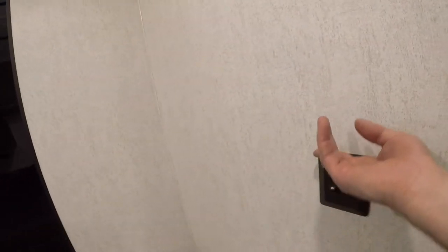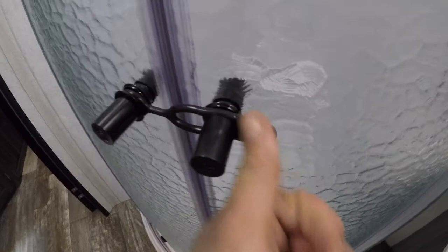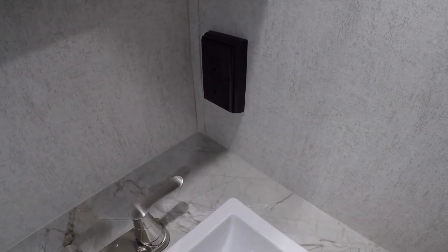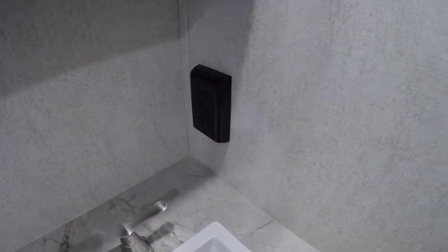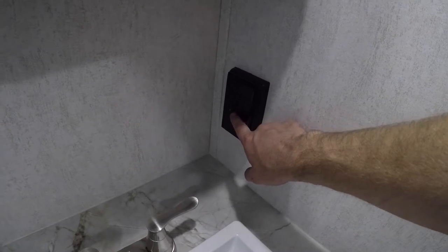So your bathroom — pretty standard. We have a switch for the lights, a switch for the fan. We have a travel lock for your shower door when you're traveling — just loop it over so they won't move around and possibly break. We also have the GFCI for the trailer. If some of your electrical isn't working and you've checked your panel and all the fuses and breakers are good, come here and check this. If you're having electrical issues, it could be that the GFCI is tripped — just press the reset button here.